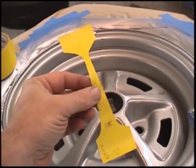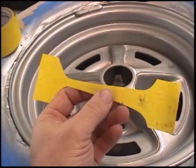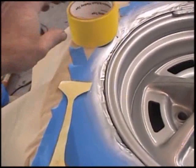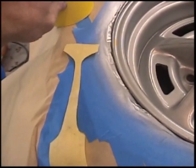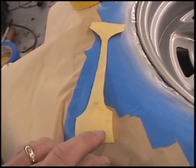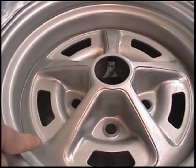Once you've cut the template out, you've still got a sticky backing from the tape. Go get some wax paper from the kitchen, lay that on the wax paper, and then it's one piece. Take another piece of tape and lay it across the backside of the wax paper, and you can cut it out again — now you have your pattern. Leave a little bit of edge. You can peel one side of the tape back and transfer it to your wheel. After the black and clear coat are dry overnight, you can take some rubbing compound and wipe those edges to remove any black that shouldn't be there, getting a nice clean edge.